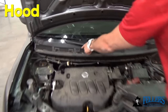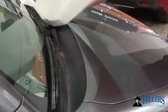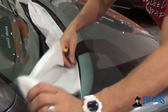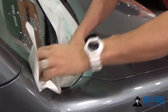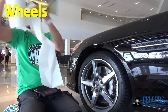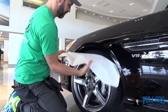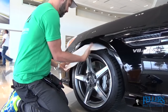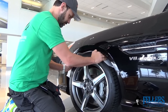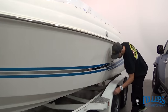When working on a hood, lots of dirt builds up in the windshield area and can take a lot of time to clean, especially for a color change where you don't want any dirt on the film. Instead of cleaning that whole area, just lay some pre-mask on top — quick and easy, creating a good barrier. Similarly, when wrapping a rim, put pre-mask on the tire to keep any dirt from jumping out. You can go outside and clean the tires, which takes time, or just take a little pre-mask — it doesn't cost much and doesn't take long to apply.